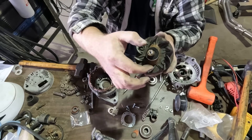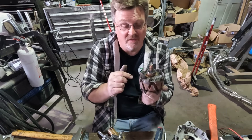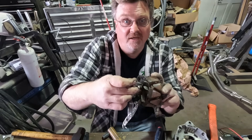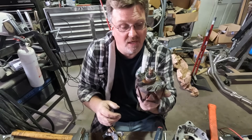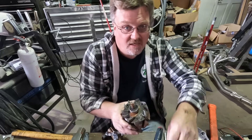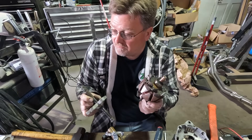So we're going to pull this off and pop the new one on. At this point it's clear as day that this was a bad idea — going and getting an alternator was definitely the smart move. Hopefully you did that and aren't trying this. What I found is I've got to pull this bearing off — it's pressed onto the shaft and I can't get under it to pull it. None of the jaws of any puller I have will fit underneath that bearing. They make specialized tools for this, and if you rebuild alternators all the time you probably have them — I do not. So pretty much what I should do now is call this a lesson learned and go get an alternator. But what I'm going to do is take a couple of 3/8-inch nuts, weld them to this old bearing, and attempt to use a different kind of puller to pop this thing off. Because I've still got a little time to kill.